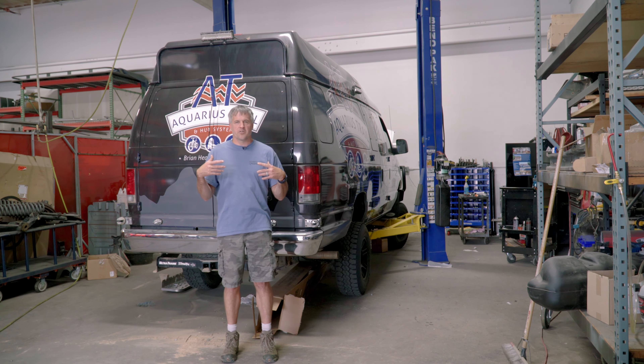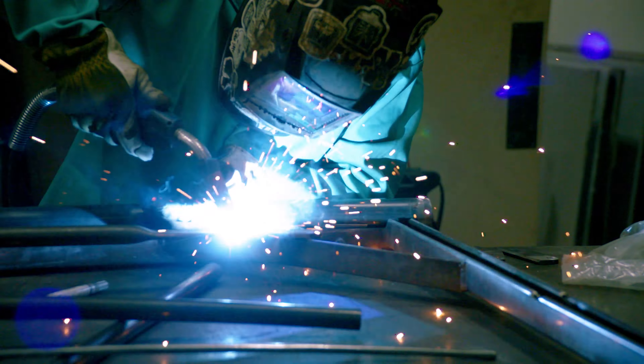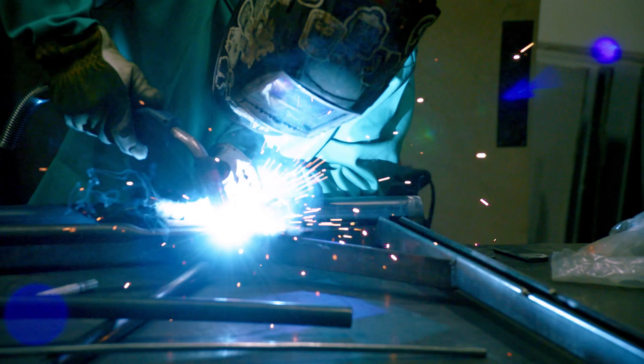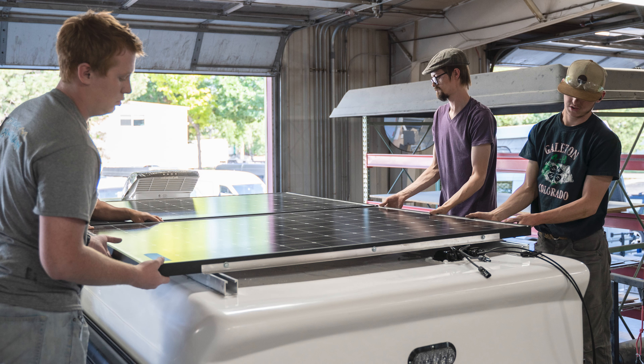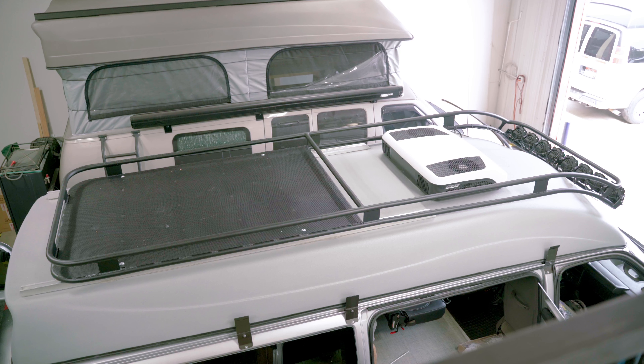This is also where we do bumpers, ladders, roof racks — all the exterior stuff that goes on a van build happens over in this bay. So we're in the metal shop. This is where they weld up all the frames and all the hardware that goes through our pop top — we designed all that from scratch and it's all built out of raw steel in here. They also build our roof racks and ladders, all the custom stuff. The reason we do it in-house and don't buy from a third-party vendor is because by the time you put solar panels, air conditioner, a fan, and all this stuff on there, you can't just buy a roof rack that works with all that. You'd end up buying a rack and butchering it up, so by building them from scratch we're able to give them a really nice, clean, custom look.